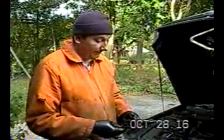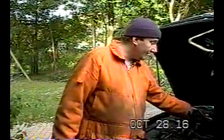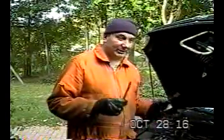So far, so good. I've taken the 10 head bolts off here. I'm going to take the 10 head bolts off in the back bank, and then we're going to start getting serious about getting this job done. But I first want to see what these head bolts look like to see whether I'm going to go any further with this job.